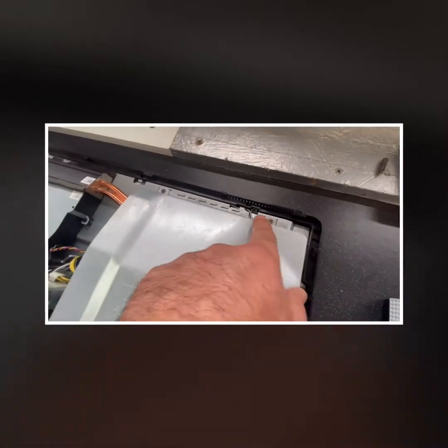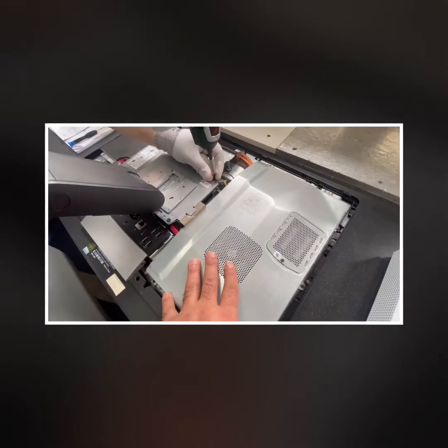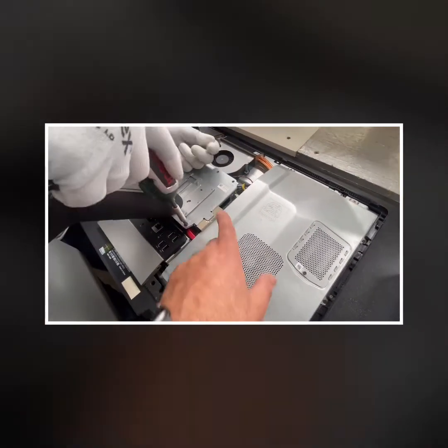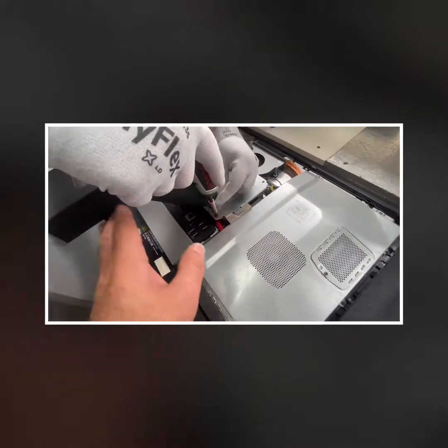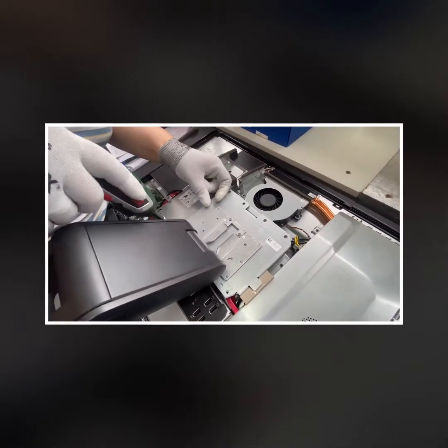You can open the other screws here to take that plate off. But if you just want to upgrade or change your hard drive, it's underneath the leg — and there are six Phillips screws holding it.